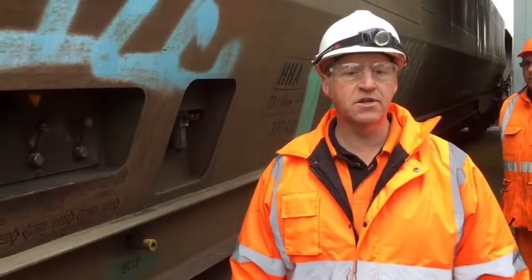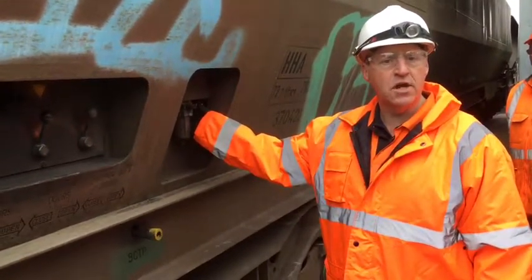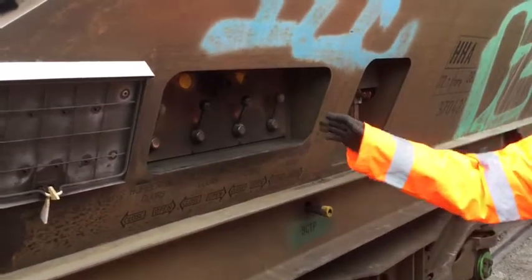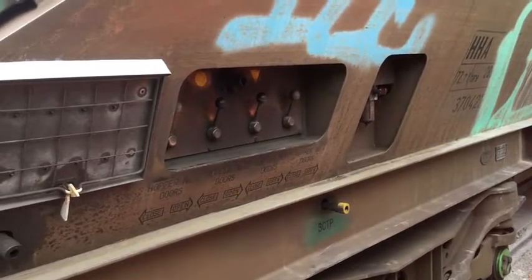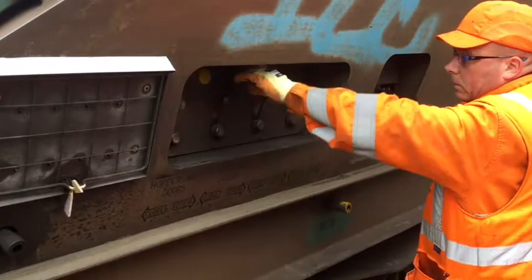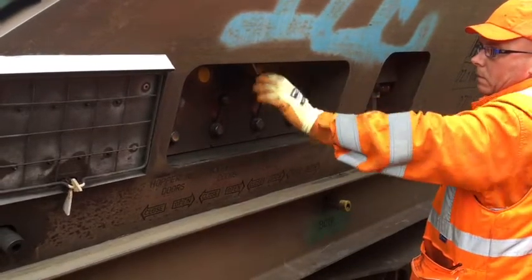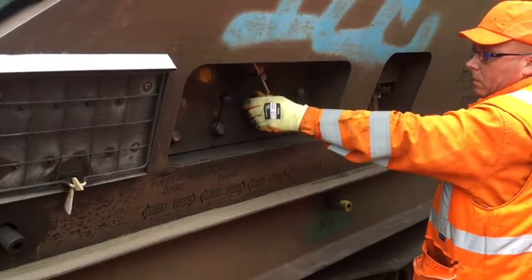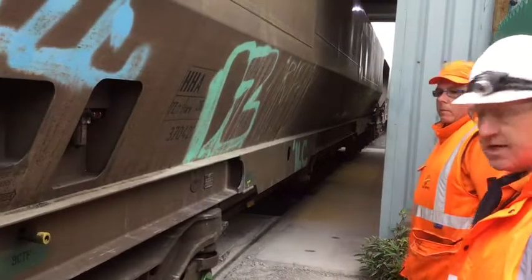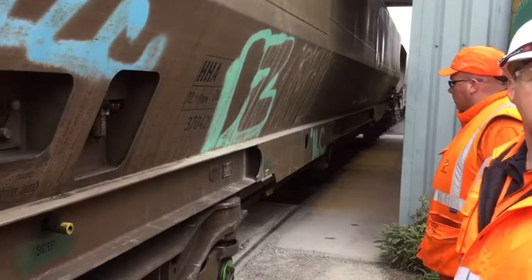We're now going to check the isolation of the air for the doors. We've already slid the valve back and heard the air pressure is released. We're now going to ask Stuart to insert his key and check with the levers that no doors will open, therefore proving that there is no air pressure in the system. He's inserting his key and we're going to allow control. We're now going to operate the levers. There's no noise coming out of the doors and I can see and hear no door operation, which now proves that all the air has been removed from the system.